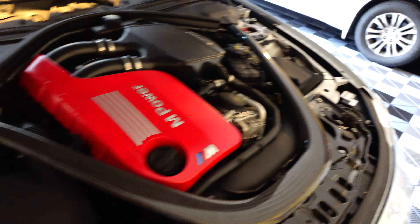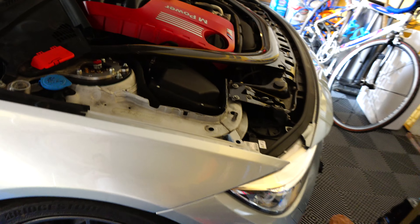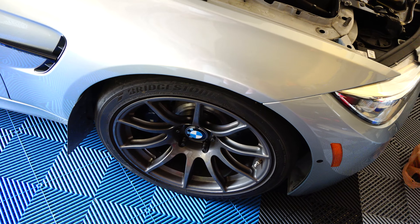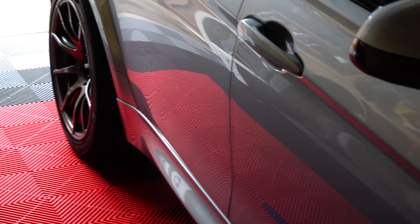I have a Fall Line oil cooler protector, which is a stainless steel piece of metal protecting the oil cooler. I did this because if I hit a cone and it hits the oil cooler just right, it might actually puncture it — so now it's pretty protected. It does sit low so from time to time it hits the road on a dip, but it's been pretty strong. I'm on Apex SM10 wheels — 10 inch rim in the front, 11 inch in the rear, though right now it's the same square setup in the back. And that covers it.